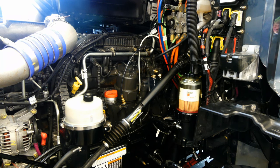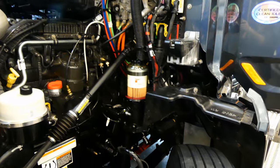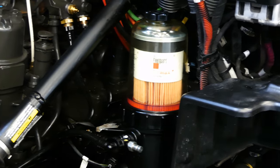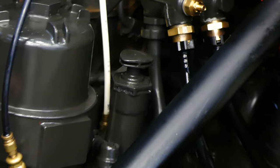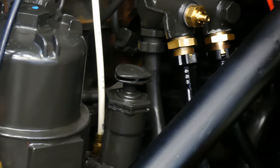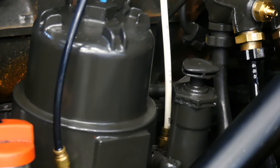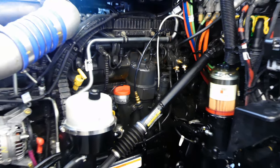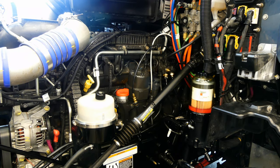Let it run for five minutes or so just to make sure everything is good. Make sure you check around the filters, primer, and lines for any signs of leakage. If the engine won't start on the first try, use the manual primer pump some more. If it still refuses to start, try using the mighty vac a couple more times. You can't prime the engine too much so do it as much as necessary. So that's how you prime a PACCAR MX up to the 2021 model year.